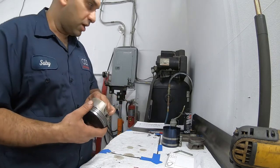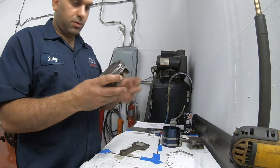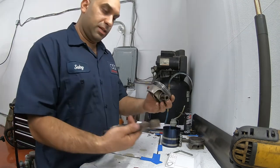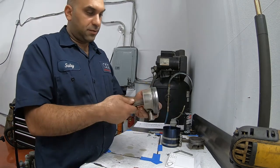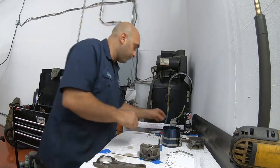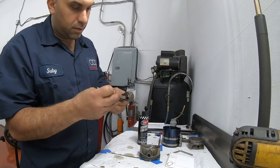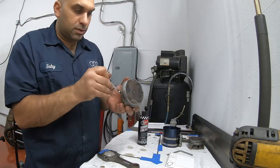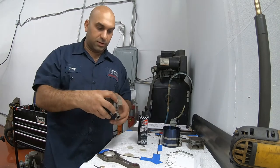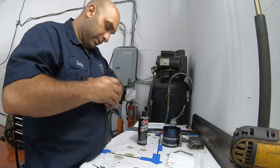Next step, I'm going to push out — this one is number 5. This is the top, and it would be facing this way. The front, the one with the mark, has got to face forward. I'm going to put it in just like that. Before we put it in, somebody lube on everything. I just put it on the rod first, then the piston — once we get the clip for the wrist pin in, then everything gets oiled up. This faces forward, and this gets pushed in.